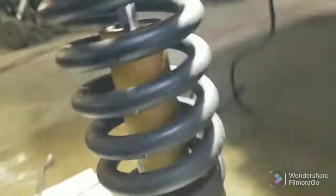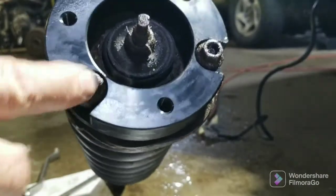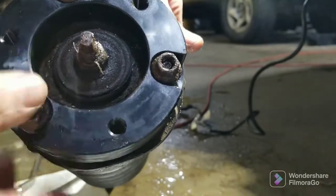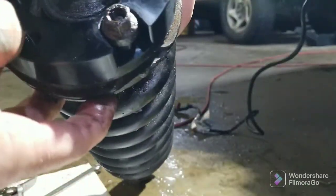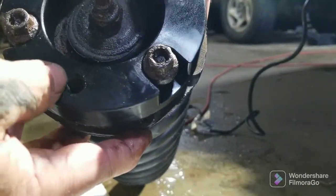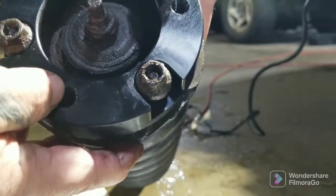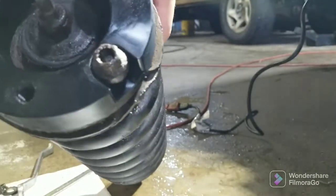So if you're not following me there, let me set this camera down. When you've got your strut on, say this is your front most bolt - after you bolt this on, you can't use that anymore. You turn your strut 180 degrees and it lines this up now with where your stud and nut were before, and you'll run the bolts through so you don't have to disassemble your strut. Hope that made sense.